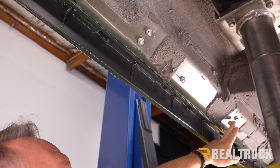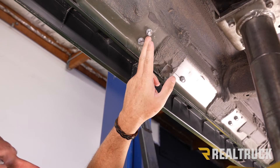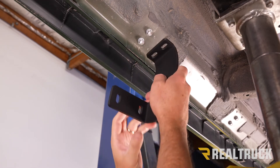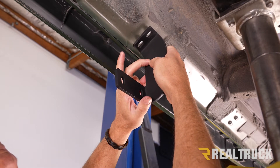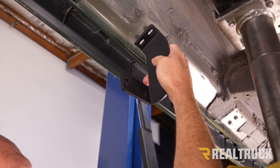As we move back along the rocker panel, we're going to skip two bolts and come all the way back to our final two sets of bolts in the rocker panel. We'll be taking these out with a 12 millimeter. This is where our final bracket goes — same orientation as the center bracket and installed the exact same way, because it actually is the exact same bracket. If it's facing the opposite direction, that's for the passenger side.